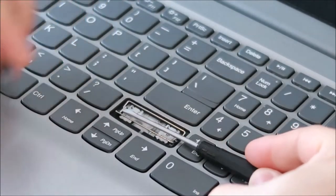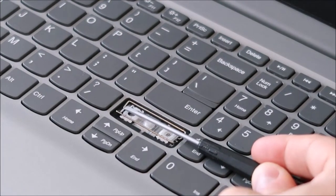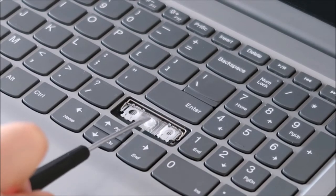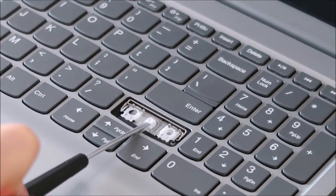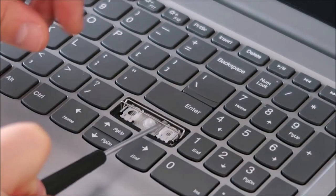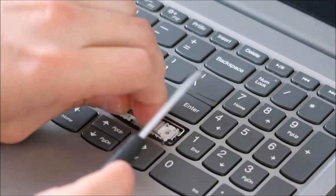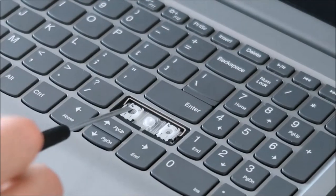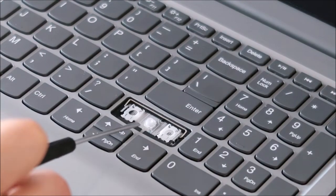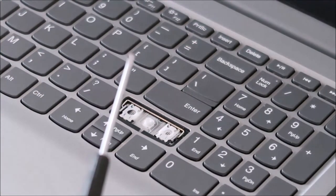As you can see, that came off fairly easily, and my flathead screwdriver is holding down those white plastic clips. This is what you're looking at underneath most of these larger keys: your normal rubber spring in the center, held on by glue — really try not to rip that off, they're very hard to get back down. You're also looking at a couple of white or black plastic retainer clips, and then one or two metal stabilizer bars. This one runs along the top, this one ran along the bottom.